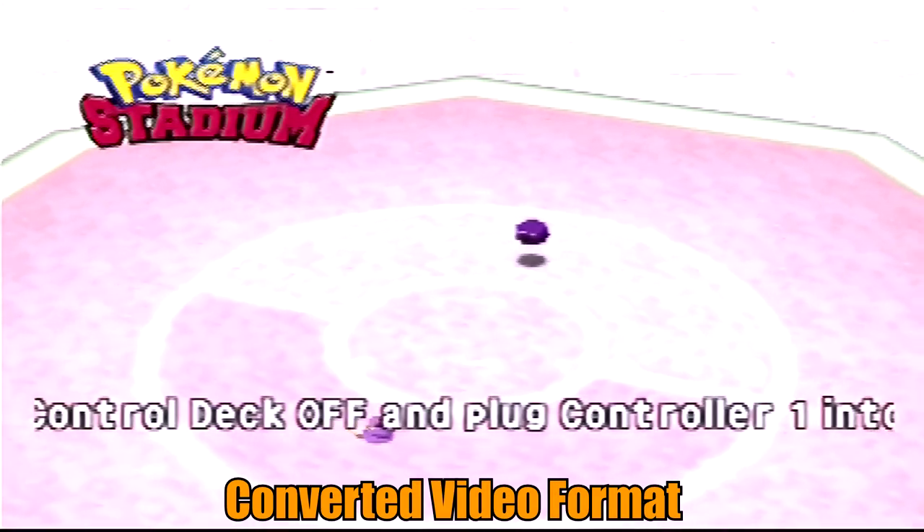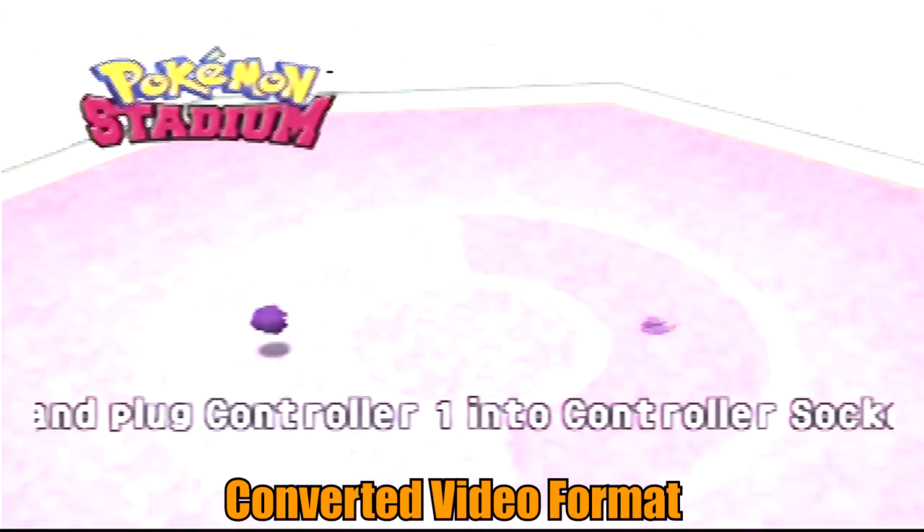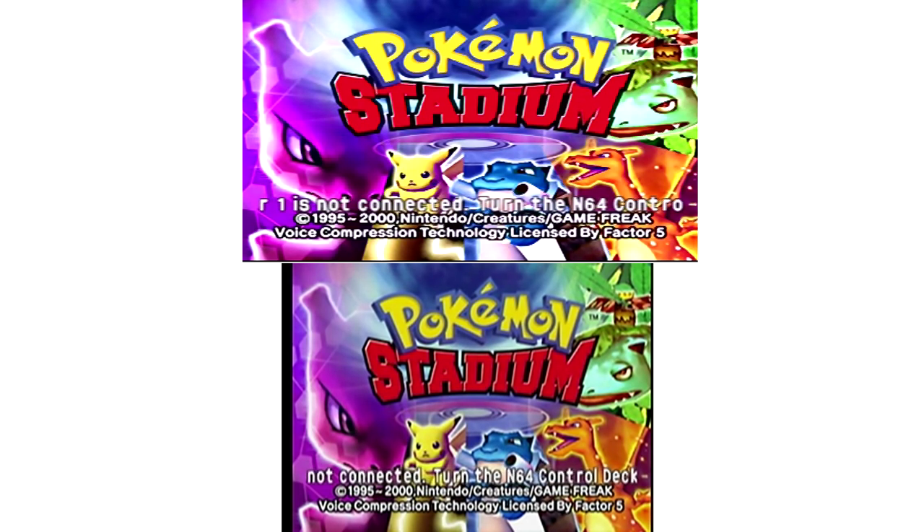I've only tested normal standard definition gameplay because I was using it for video games. I didn't have any games that actually supported widescreen for standard definition, so I don't know if you use a widescreen standard definition game with this converter whether it will add extra bars at the top and bottom of the screen when converting to high definition. I can say that when you're using a standard definition video game or any 4 by 3 video source, it will stretch it to a 16 by 9 aspect ratio. Also, this is only composite in and HDMI out — if you want HDMI in and composite out, you cannot use this and have to buy a completely separate one.